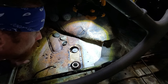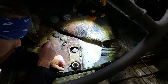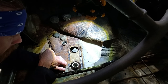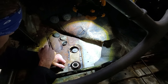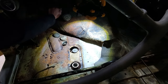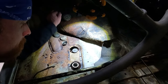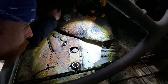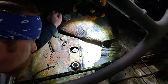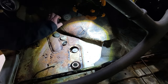I just got a little bit of back pressure on the clutch and I pushed it. Something broke free. Possibly the, is there a slave cylinder on here? And then it stopped bubbling backwards and the clutch pedal came back by itself. Is that a good thing? Okay, it's still bubbling, but it's not bubbling as much. Okay. There are zero leaks under the car. Nothing leaking. Maybe it just needs to be bled out.